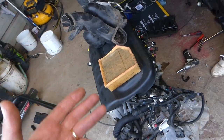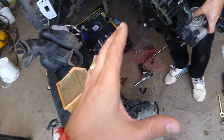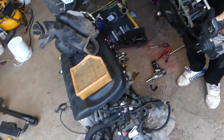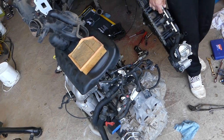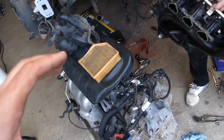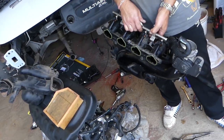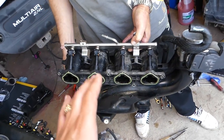To fix it you need to take the whole engine apart and replace either the crankshaft or the connecting rod. If you do that immediately it's possible, but if you let it sit for a couple of weeks, the engine block and everything will rust, and as a result you'll need pretty much a new engine — or an enormous amount of money to rebuild yours, bore it out, and put in bigger pistons.